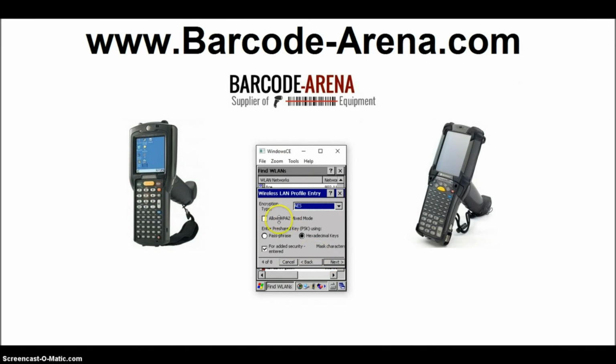Authentication type is none. And here's where I would check on allow mixed mode. Double check how your network is encrypted. It's either going to be AES or TKIP. And you need to make sure that you've got that matched up, or the device will not connect unless your encryption type matches how your Wi-Fi network is configured. Passphrase is how we're typing it in, just a regular password.